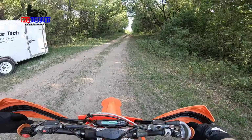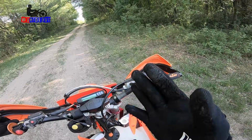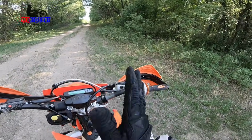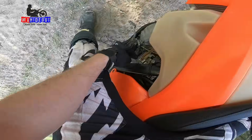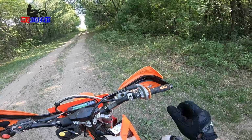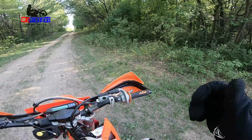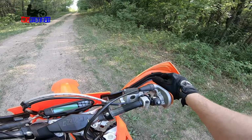Really close. But I went 1/4 turn richer on the metering rod, and I forgot to check the length again. I'm guessing it's 2-inch 140 thousandths, and it's a little bit better. It's still not perfect. I ended up trying richer 1/4 turn at a time with this power jet on the top end and whacking the throttle. It's better, but then when you rev it out, it's sputtering rich. So I don't know, there's no real good compromise.